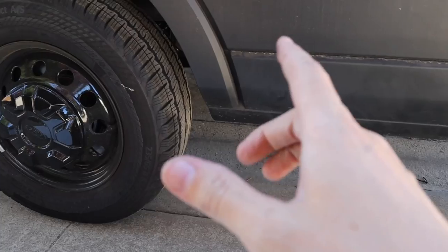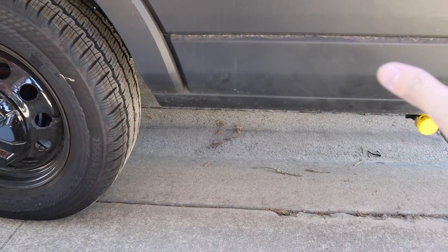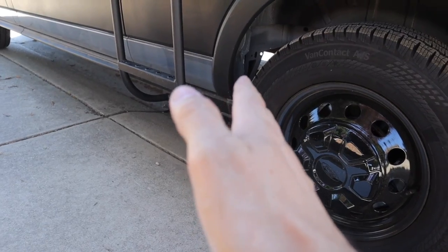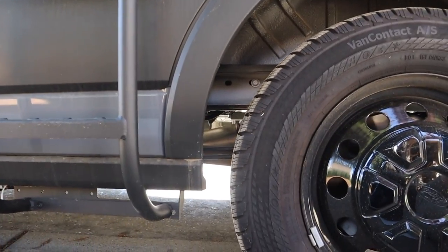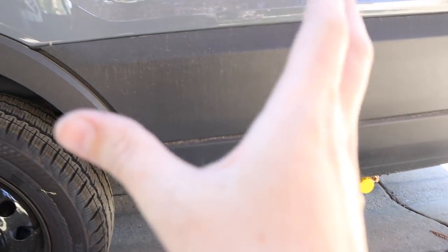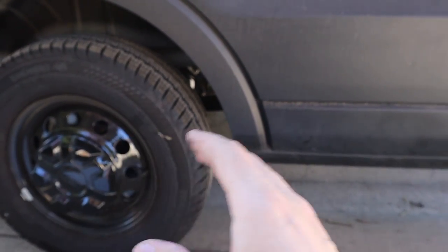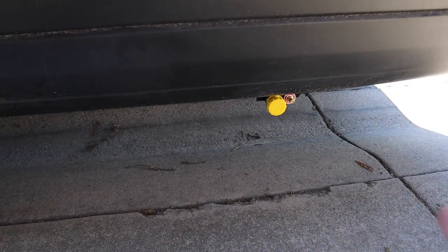Even after relocating everything, I put it a little bit far back from the tire because I don't want rocks kicking into the remote fill as much as possible. But not so far back that it should drag. The other option would have been to put it up here, but I have my ladder and the hose wouldn't have reached past it. Right on the other side of that ladder is our gray tank. The passenger side could have been viable, but I didn't want to run my hoses anywhere near the exhaust and all the heat that puts off. So this is the compromise and ultimately is going to be a good spot.